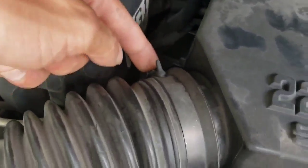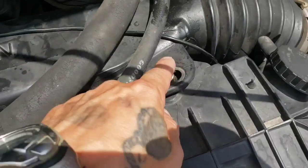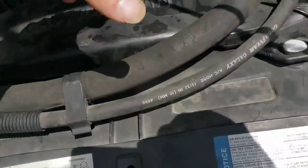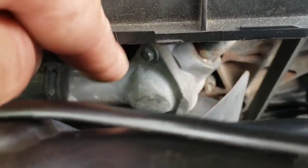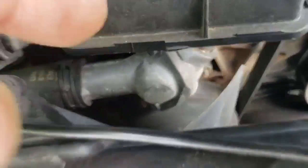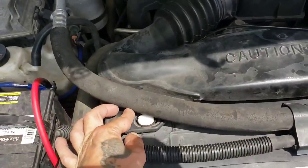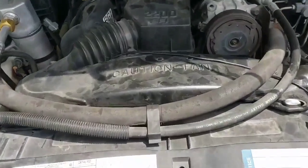In this truck the thermostat was real simple. I just undid the screw for the air intake, pulled this piece off — the clips were broken, this one had no top and they had it zip tied. I cut the zip ties and pulled the side out, lifted this whole piece up, slid it out, sat it off to the side. Then for the thermostat you see that upper bolt there and another one down on the bottom — undo those. I didn't even have to undo the hose, it just came right off. Plucked the old one out with a screwdriver, the seal was already in there, cleaned it up, put the new one back in, bolted it back on, redid the clamp, and used universal pins instead of zip ties.